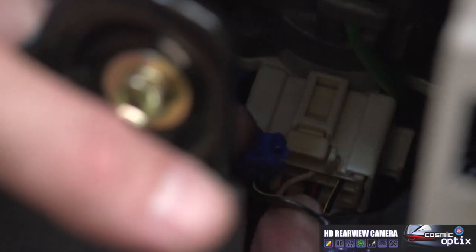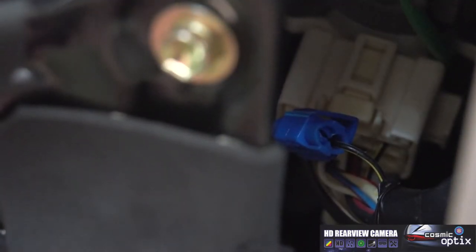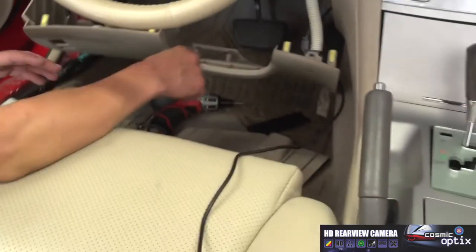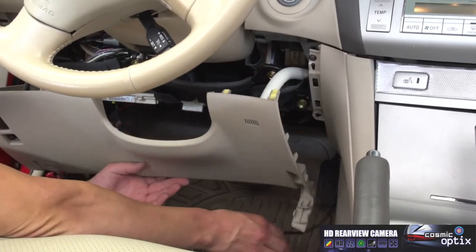Which takes a little second here. I'm trying to do this so that way you can still see what I'm doing. So now we're going to take our channel locks. Okay, now we've got it clipped on. So our 12 volt switched is now connected right into our ignition. So now we're going to go ahead and feed our wire. We'll zip tie it up here and get everything in place, and then we can put this back together.